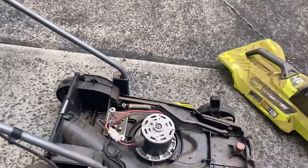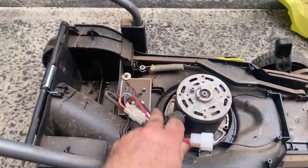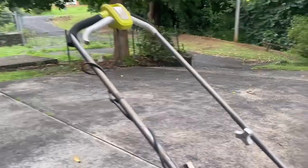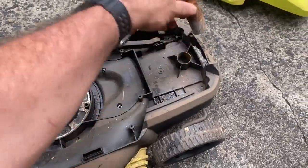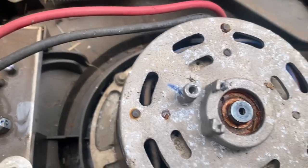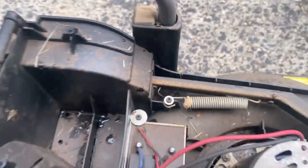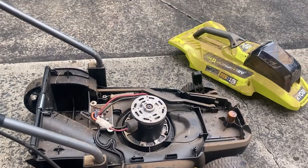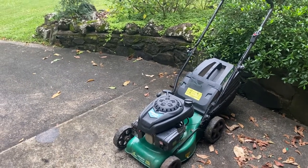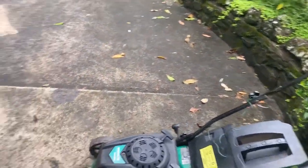For anyone wondering what's inside these battery powered mowers, that's about the extent of it. Wires to the battery pack, a little control module on your motor with a switch, and this little dinky weight in the front just to keep the nose down - there's no weight to these. I'm just going to give that motor a quick clean out; it actually has grass growing in it. I'll roll the rest of this water out and have a good battery powered mower. I've revived a perfectly good mower that pretty much the entire community at the moment are throwing out into landfill.